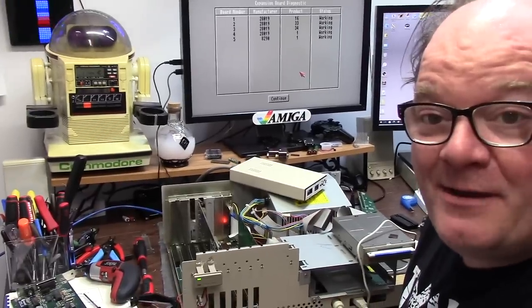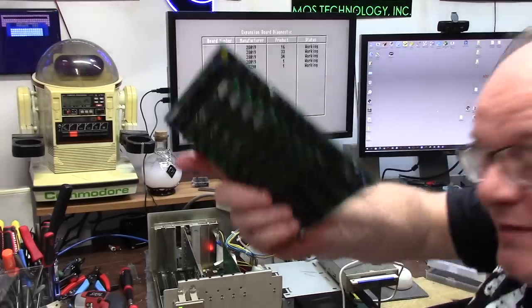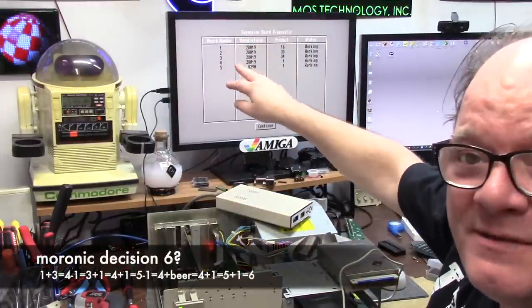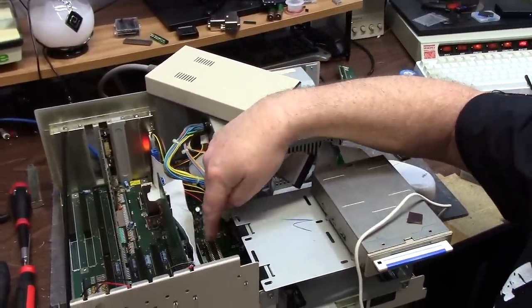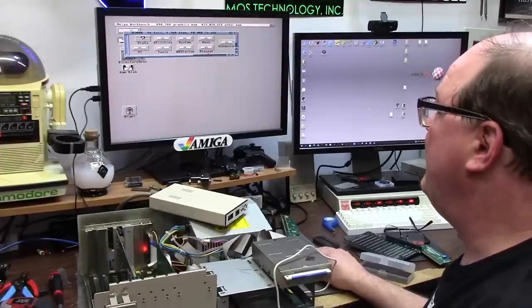This just goes to show you what goes into a video, and you realize you forgot to put in your accelerated CPU. Hi, welcome back - crazy hour, it's 11:44 PM on a Sunday night. I ended up putting my PiStorm in here. I tried the Amiga Kit CPU adapter - that works but it's got all these interrupt requests, so I finally pulled this board out and everything decided to work. That really hurt. PiStorm is in, all that stuff up top is PiStorm stuff. I put the Kick 3.1 ROM on the PiStorm - we are on the CPU riser.